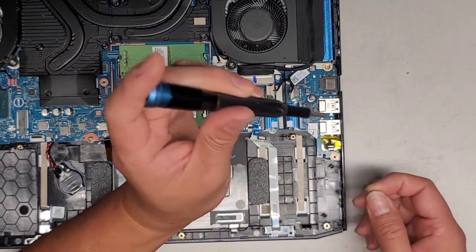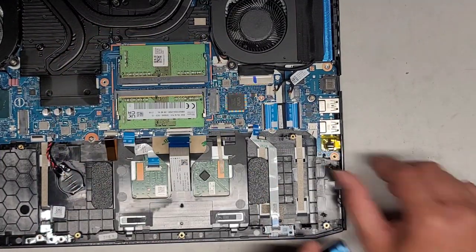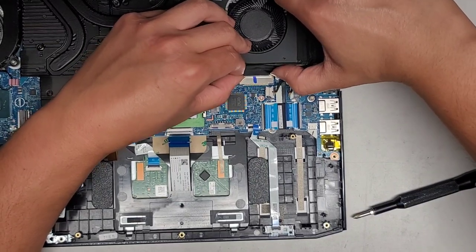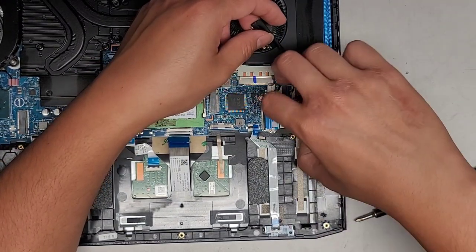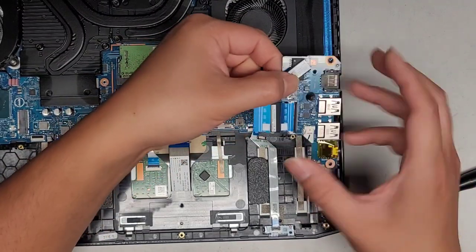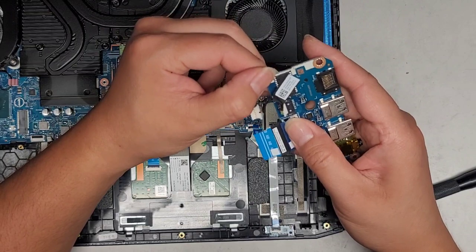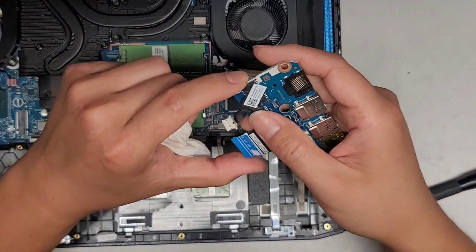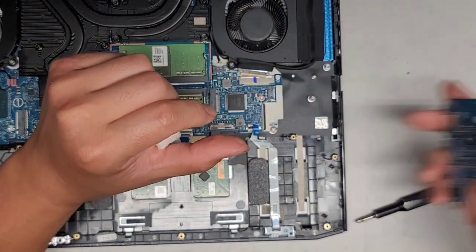It looks like this little board is a separate one, so flip these latches to pull the cable out. There's also a cable here holding and connecting things — grab the wings and wiggle to pull that back. There's one screw here holding it. Let's go ahead and remove the LCD LVDS connector since it's in the way — same thing with the wings, just wiggle it and there we go. We can move that connector out of the way, then try and lift this up. Back looks okay, so we'll set that aside.